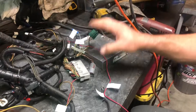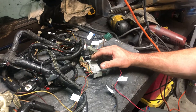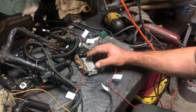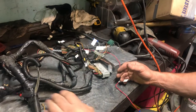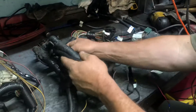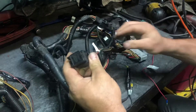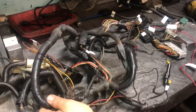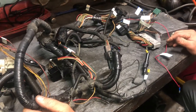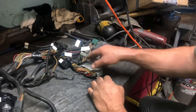This is an A9P computer. This harness is out of a 1992 Mustang. This video applies to the 92 and 93 harnesses, which I prefer for a fuel injection conversion on an older Ford because it has a built-in fuel pump relay versus the earlier models that had the fuel pump relay underneath the seat, where you have to wire in a separate circuit. Much of this will pertain to the earlier harnesses, but some will be different, so I only guarantee this for the 92 to 93 cars.